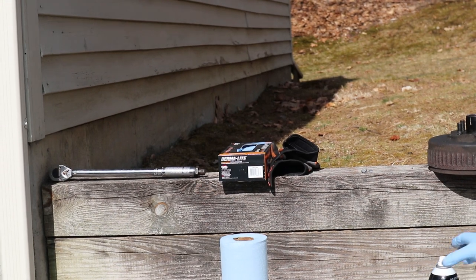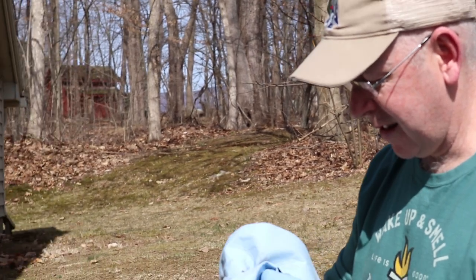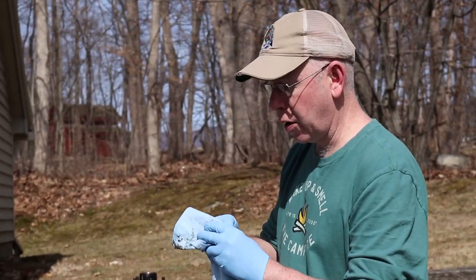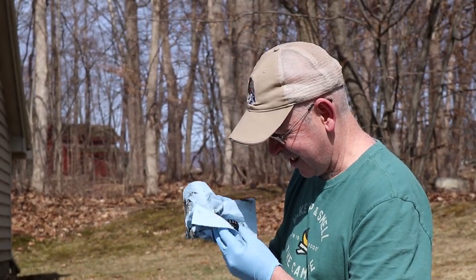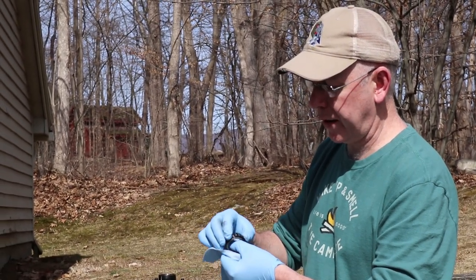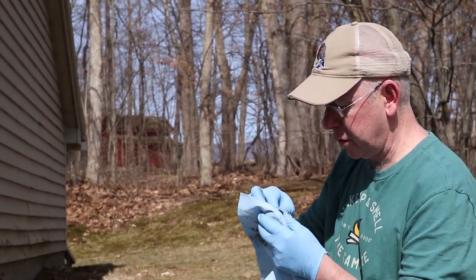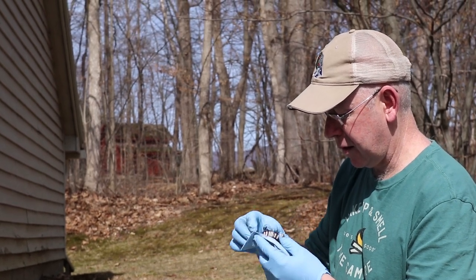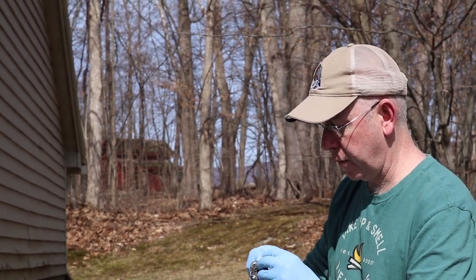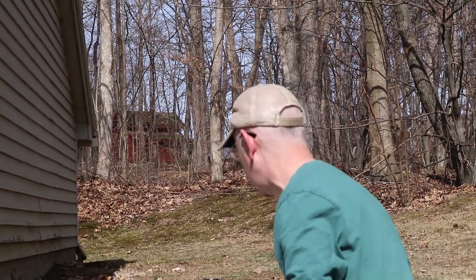That's the wheel bearing? Yep. There's two of them per wheel, right? Yes. See the stuff I learned? And they only go in one way. And you're making sure that all the little bearings are turning, the needle bearings, and that there's no discoloration, or they didn't turn blue, which would indicate overheating. Or what if, could some of them fall out? No. I just don't know. Yep. It's moving freely though, which is good. Always have a lot of garbage.